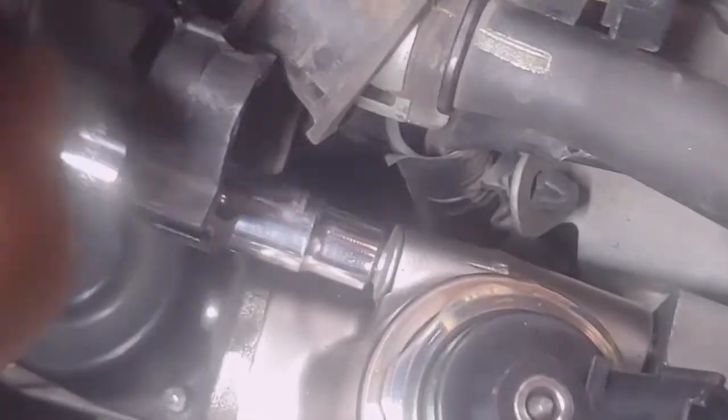Yep, go ahead and just snug them. Make sure you don't tighten up one all at once, because I like putting everything slowly back in place. Make sure you go opposite ends. Honestly, I think I did it right. Start with the front, go to the back. This guy's a little loose, so I need to actually hold it a little bit, that way the ratchet can click.